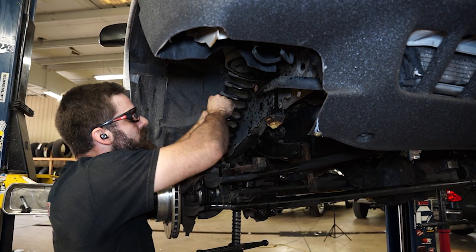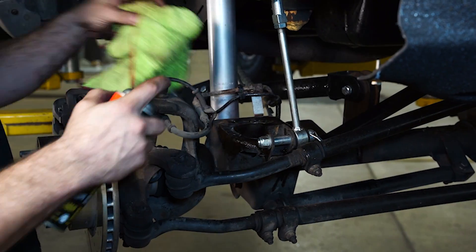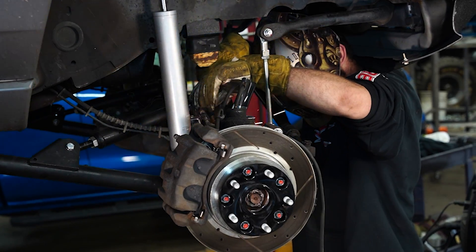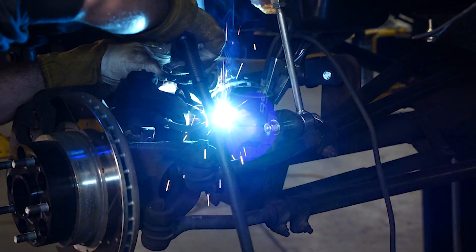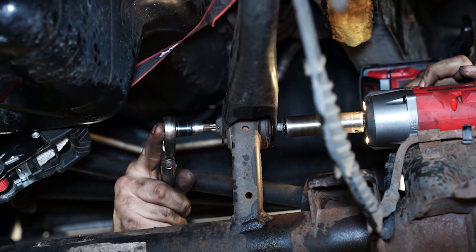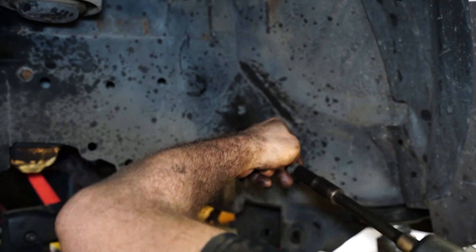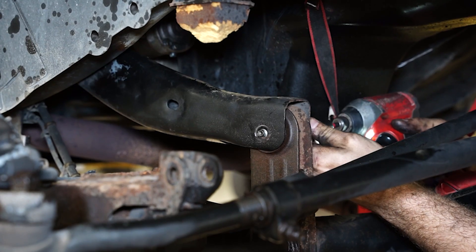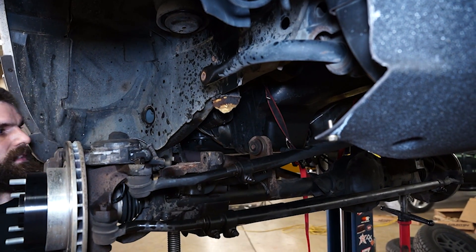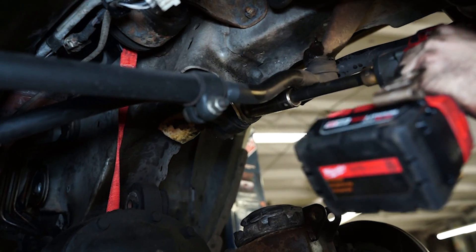The axle mounts for my springs had rusted off. I actually go back later on after this install and weld in a piece of — I believe it's three and a quarter inch quarter-inch DOM tube — weld that back on there, which basically replaces the part that had rusted off. After I get the control arms disconnected, what I end up doing is the track bar, or panhard bar, whatever you want to call it. One thing to keep in mind: 99% of the time when death wobble occurs on a vehicle, it is more than likely the track bar. One thing that's nice about this kit is you do get a new one.